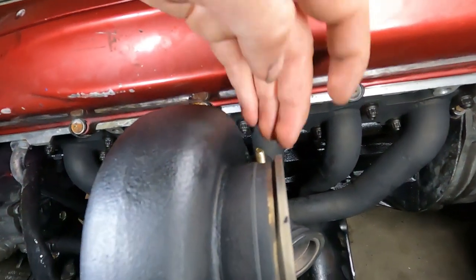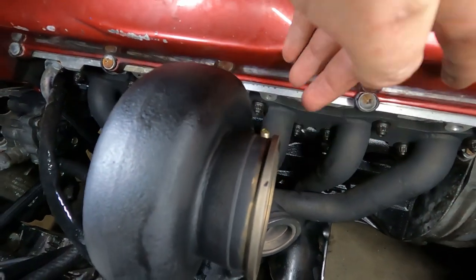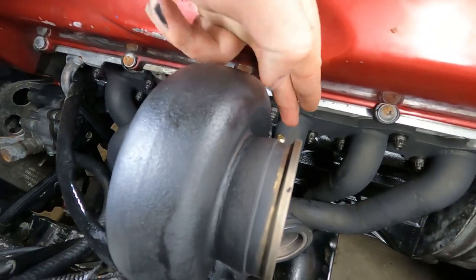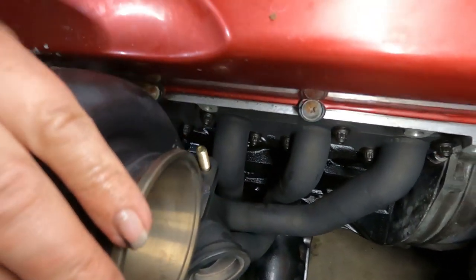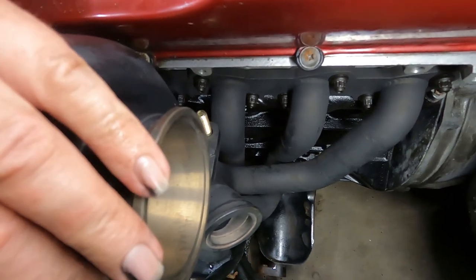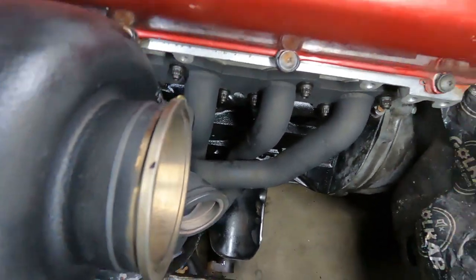And we've got our E-map port off the back here, which points a little bit more towards the engine to give you a little bit more room for your V-band, just skimming over the other side of the top of that stud. So hopefully we can skim the fitting in there. I might test fit that now and then I'll show you how we're going to do that.